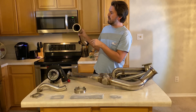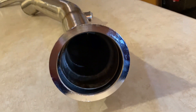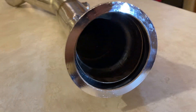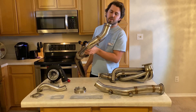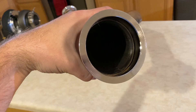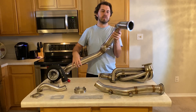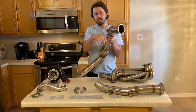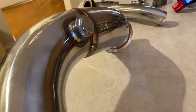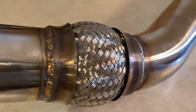The downpipe isn't welded on the inside — I'm going to go back through and weld it or mushroom it out to smooth that out. The second portion also isn't welded on the inside, and I might weld that too for a nice smooth flow. This second portion has the wideband bung, and all of these came with blanks so if you're not using a wideband you can block it off. I like that it's got the flex pipe, and this does give you enough exhaust to get you out behind the trans, though you do have to complete the rest of the exhaust yourself.